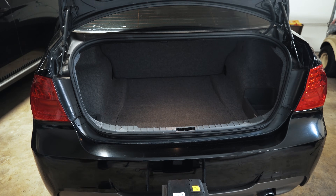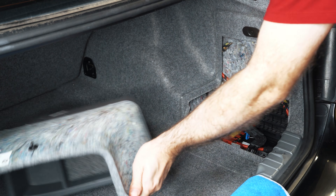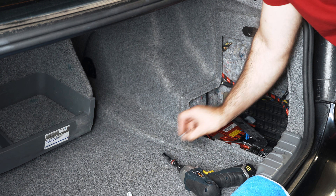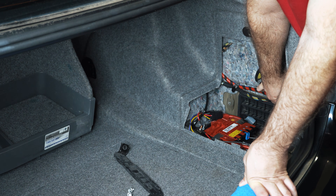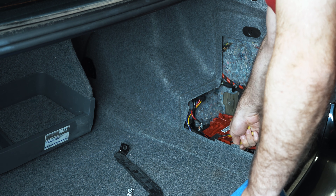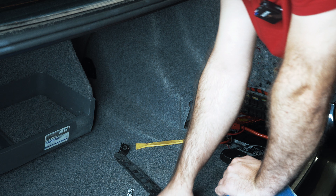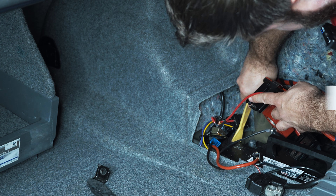Let's get in the trunk and remove the old battery. Always put a cloth over this because if you close your trunk you won't be able to get back in. Starting with this brace — 10mm. Then 10mm on top of the negative battery terminal. On the side of the battery there's also another hold down — 10mm — so I can get to the vent line.